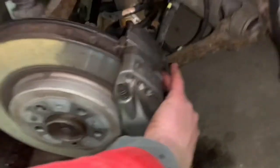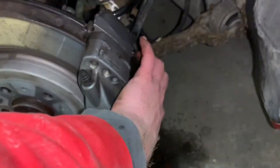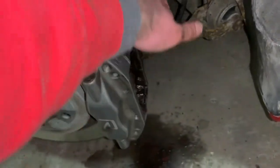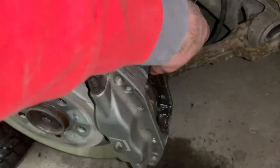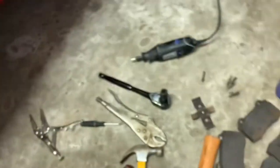It's the next day. I soaked the two stuck pins in WD-40 overnight and into the evening, and I bashed them out — no more cutting needed, just a lot of hammering. I got both out. Here are the remainders of what's left of the pins.